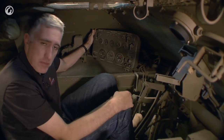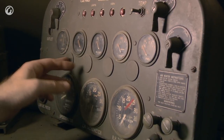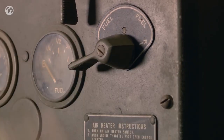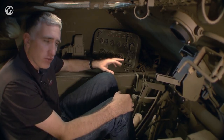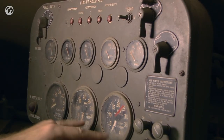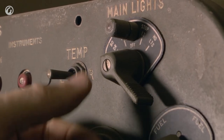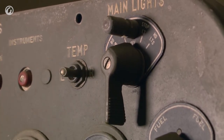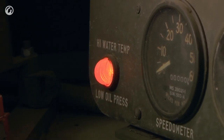Controls to his left — the typical panel, you've seen something like this with the M4A2. So obviously we have the panel lights. Electricity — it's got two sets of oil pressure, obviously one for each engine. Temperature, fuel — you would select which tank you want to look at with your selector. The manual does recommend that you use one fuel tank to dry before you switch over to the other. Speedometer, two tachometers — one for each engine. Starter buttons — one for each engine. The main lights include blackout marker, blackout drive, stop lights only, and full headlights. There is a toggle to select which engine's temperature you wanted to read, and there are circuit breakers. Finally, there's a warning light for water or pressure.